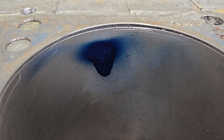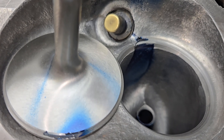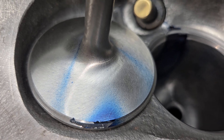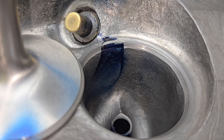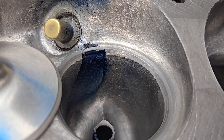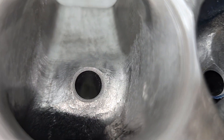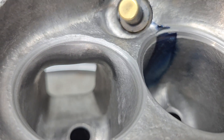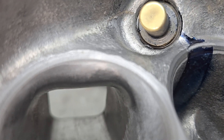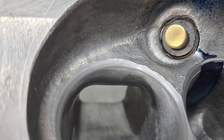The valves themselves are not textured — we'd probably lose some CFM if we did that, but it's something to think about. We're also not using a back cut because it's a high RPM setup. You can see on the valve where the seat lies. There are actually five angles on the seat. The exhaust heat crossover — this exhaust worked bizarrely well. It's a relatively thin valve seat, and I'm not going with a thick valve seat on these.